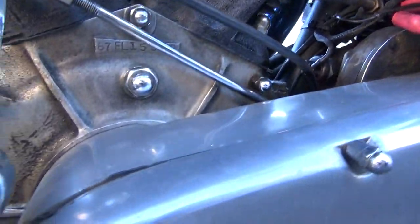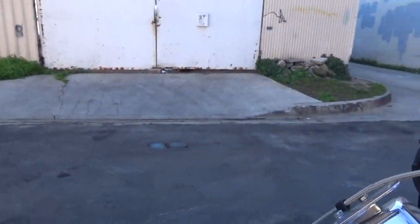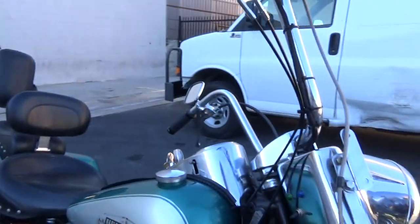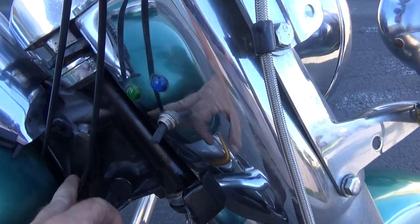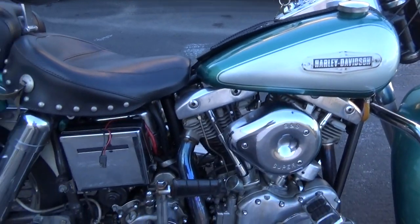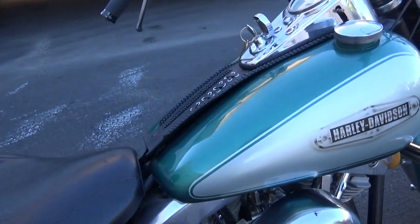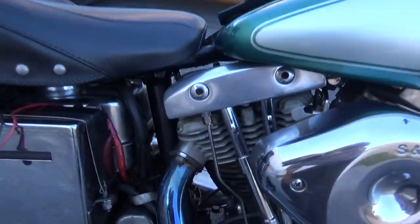Well, we've got very good motor numbers. So, early heads, wrecked heads. You see the oil there in the front cylinder? We definitely got a blown rear gasket. So I think it's just head gaskets. But I'll just bet that somebody cracked a frame and they got a Harley frame, because this looks pretty clean here. They didn't grind it off and try to fake numbers, so it's probably just an unnumbered early Harley frame. That's what I think it is. But until somebody gets in there and finds out what you've got. See, we definitely got a blown rear head gasket there.